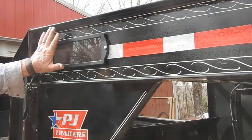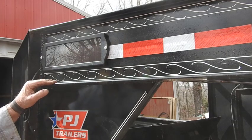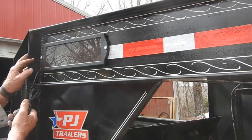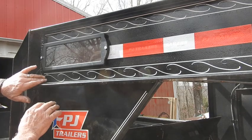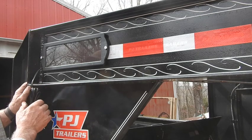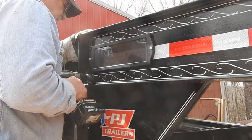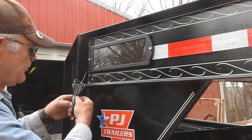If I feel a need, I can always put a piece of plexiglass right over the front of this to kind of protect it. I don't think we're going to need it, but always have that option. I think I'm going to use a unibit and drill a hole right through there. This does not unplug, so I'm going to have to drill a hole big enough for this to go all the way through. I need to go through up here — not on this flange or below this flange — because that could get rubbed off in brush when you're going through the woods. So I'm going to drill right through here — it's going to take a half-inch hole. Then I'm going to have to go get a plastic or rubber strain relief for that.